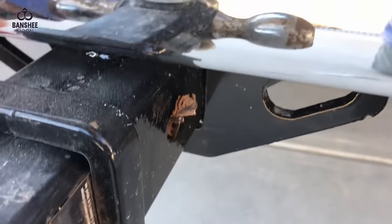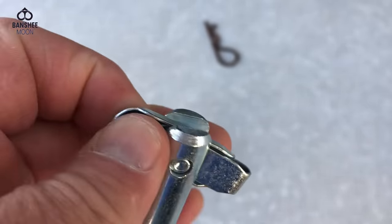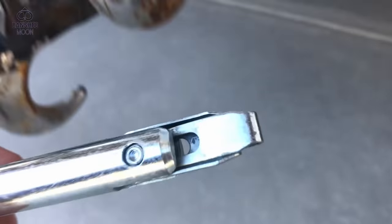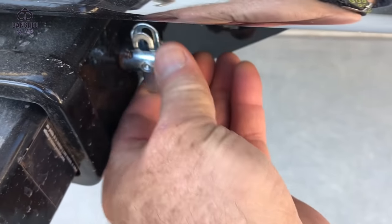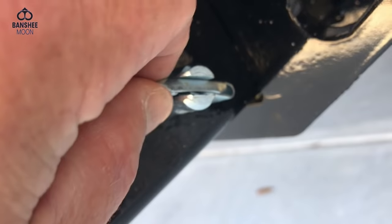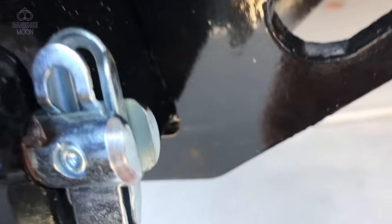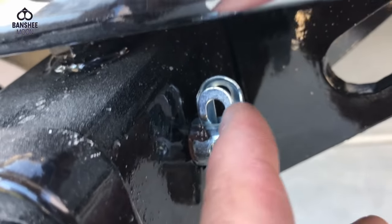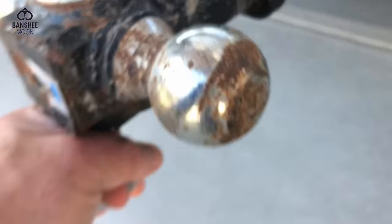So I'm going to pull that off, slide it out, and cast it aside. Watch this — you just squeeze this, push it through, and straighten it. Put it through and flip it, then push it into place. See how it's made on the end — when you squeeze you can push it into position, but when you pull it through it spreads out and stays in place. An added feature: it's called an anti-theft hitch pin. You can put a lock here to ostensibly lock your hitch in place.